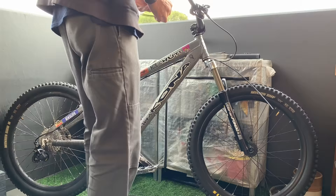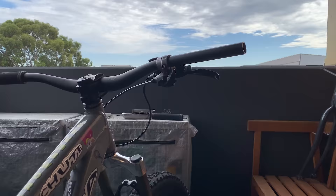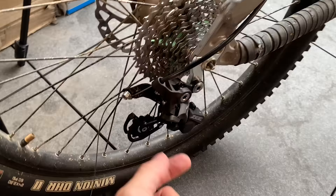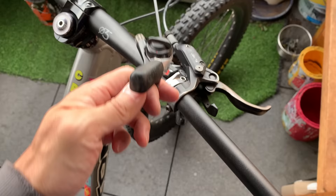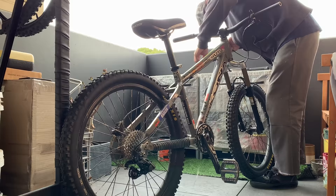Now I can use this shifter on the other bike — that fit, no problem. Just rewiring it again. After all that, I should have checked first, but it didn't work. A 9-speed shifter and a 10-speed derailleur have different pull ratios, so I'm going to have to try to run friction again. Usually 7, 8, 9 speed stuff is all interchangeable, but when you get to 10, 11, 12 it's a different thing. It was a little bit of a pain switching it back and forth, but lesson learned.